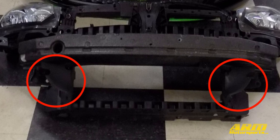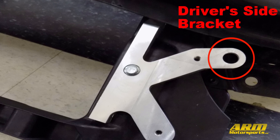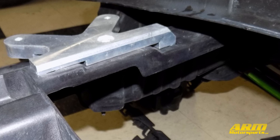Next we're going to remove the two rubber air guides on the front of the bumper assembly. They're not installed with any screws or bolts so you can just remove them by hand. Underneath we'll find two square cutouts — these are where we'll insert our aluminum brackets. The bracket with the extra mount on it is for the air temperature sensor and should be installed on the driver side. To install the brackets, insert the two square ends through the square holes and then pull down until you hear a click, which lets you know it's locked into place. If installed correctly it'll sit flush like shown.